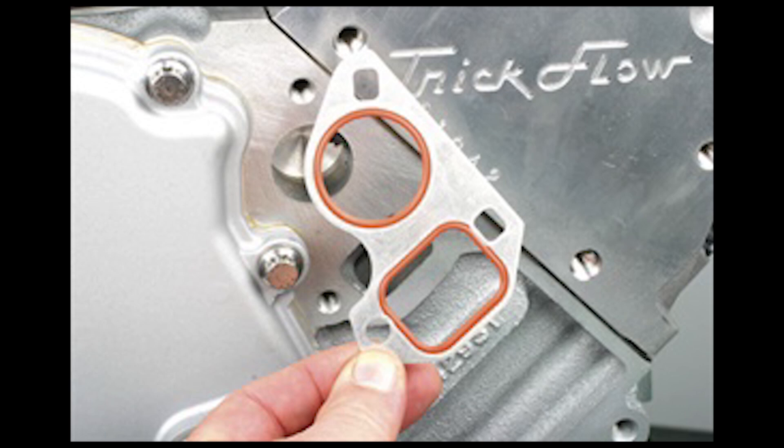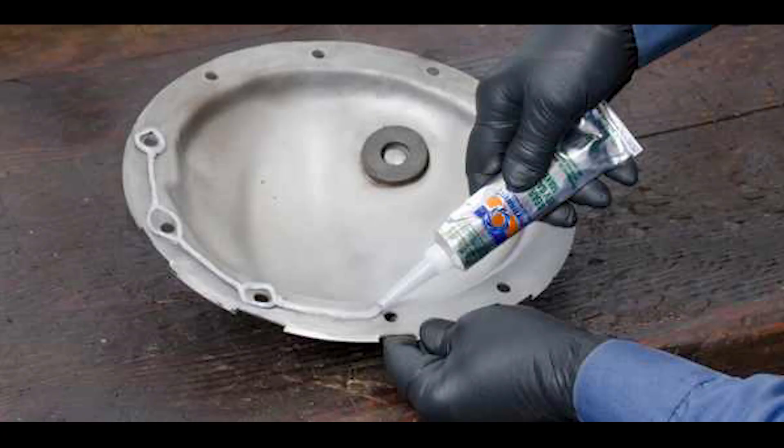You can use this on the gaskets for better sealing. If you don't have a gasket for your old motorcycle like the 2-strokes, then you can apply the silicone on both the surfaces and tighten with the bolts — simple, that's it.